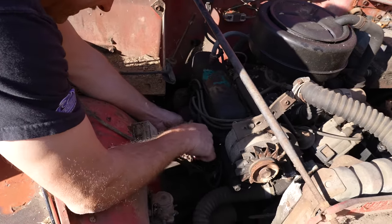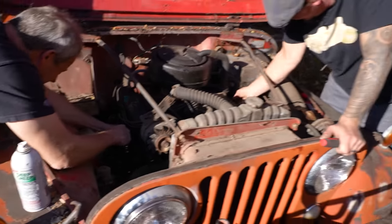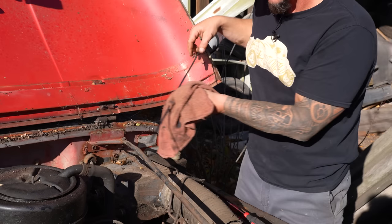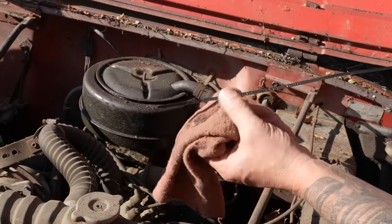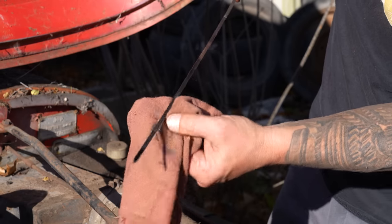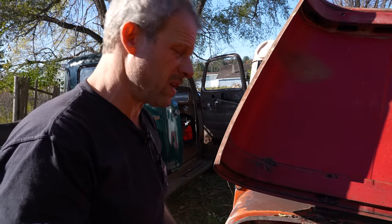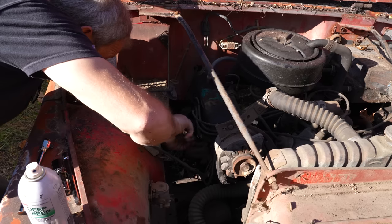You left me the good side again, I see. That one didn't raise the little dummy. Holy cow, how do you even get in there? These are pretty caked in here from oil. At least mine are. I always like to see the condition of the oil — we've got oil all the way up to O, that's a little bit extra. Maybe water, maybe fuel. I still can't get the socket on them. The way the head is shaped, it's a tight fit, and any extra growth because of rust or dirt kind of makes it a pain. I really wish I could get in here from this side.